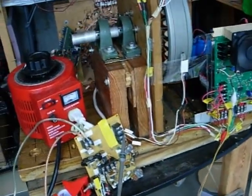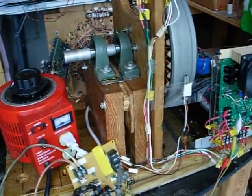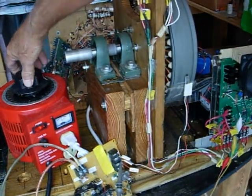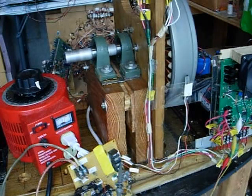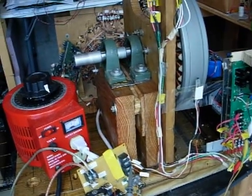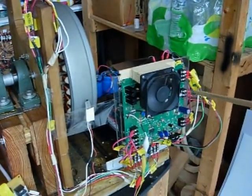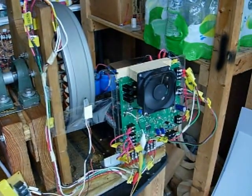Let me zoom in here a little bit and let's crank this thing up. Right now I'm doing about 30 volts or something. If I crank it right on up to the maximum — 130 volts out of the variac — I'm getting a speed of about 300 RPMs. On the PC board I'm seeing the high voltage input reading 191 volts DC, which is probably right considering the variac's at 130. Normal 120 gives you 160.